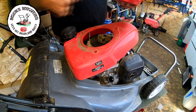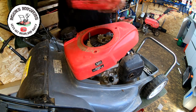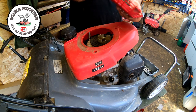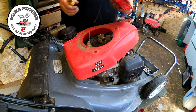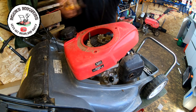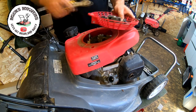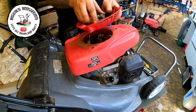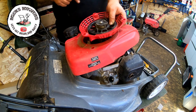Pull the cord all the way out, like so. Snip that bit off. Keep the tension on the pull cord at all times. Take that out. And then we're going to thread this new bit of cord into there. We'll go one more rotation. No, it won't. So, new bit of pull cord just in there, and I'll come back.